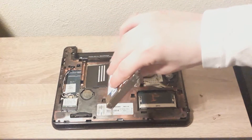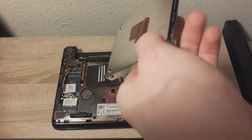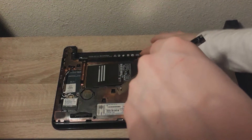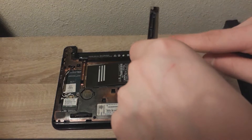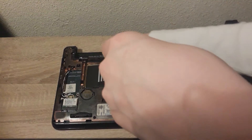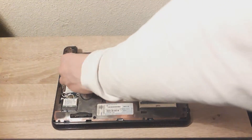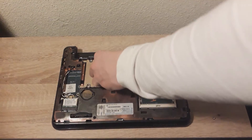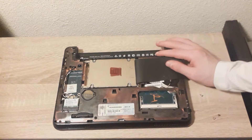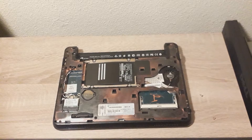So now that the hard drive is back in the caddy again, you want to make sure that the SATA connector — this is right here — is on the top side at the battery side, and it's facing to the right. You lift up the tab once again, slot in the hard drive, pull this tab, and it comes right into place. You can get the tab back over it again and screw the hard drive caddy down.